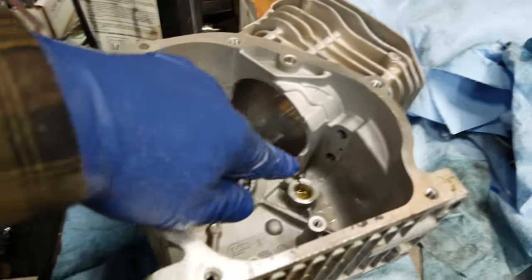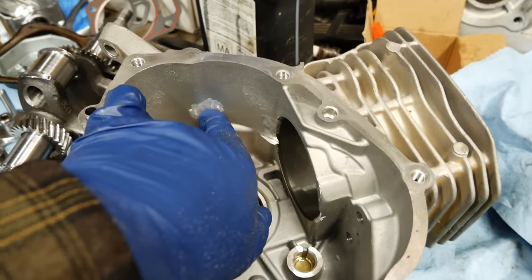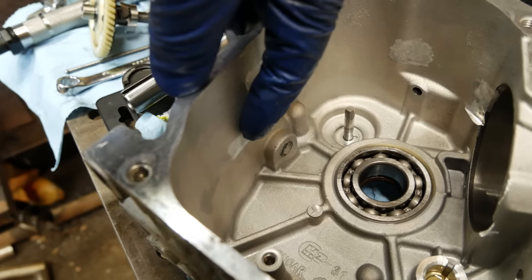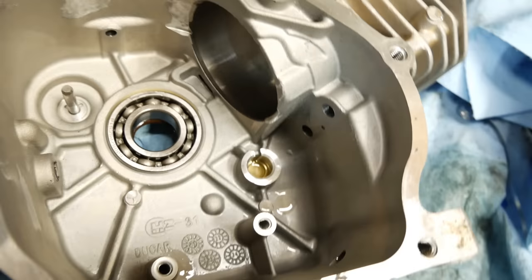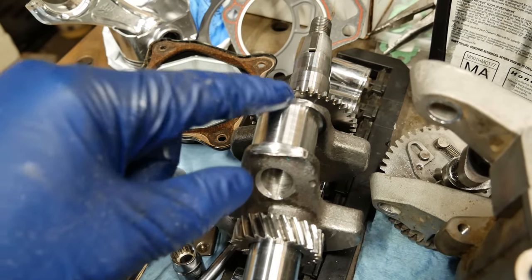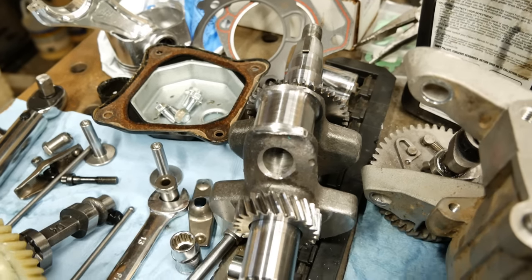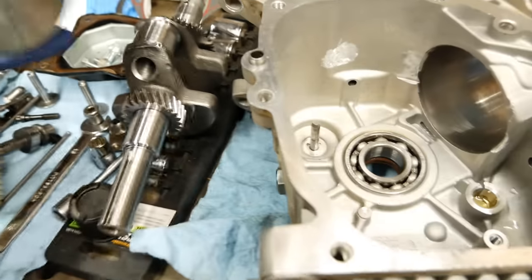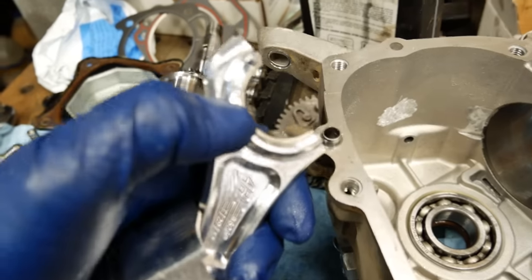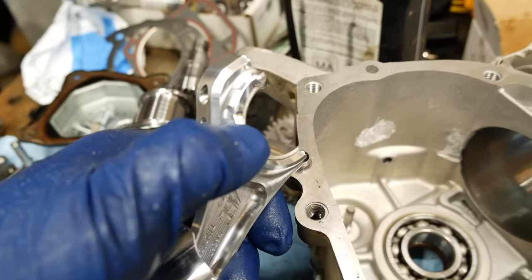So on my block, I had to clearance it right here for the connecting rod, up here a little bit, right here for the hardware on the connecting rod. Back here for the dipper, and I had to take a little bit off of here for the cam I'm running. This is already clearance on the stock cam. I just had to remove a little bit more, and kept dealing with the cam lobe just grazing past this connecting rod. So right here I clearance just on top of my thumb just a tiny bit,